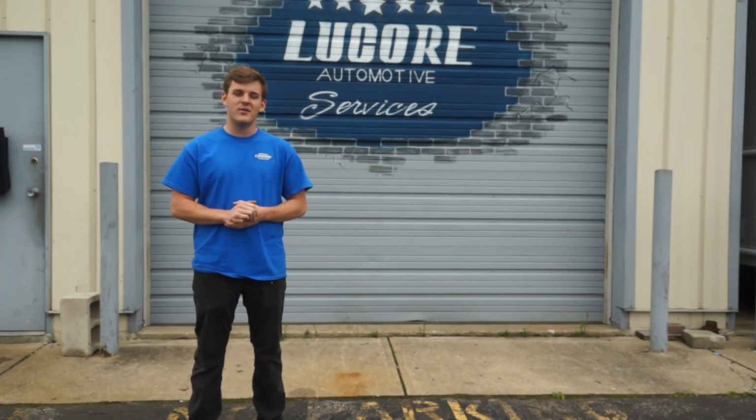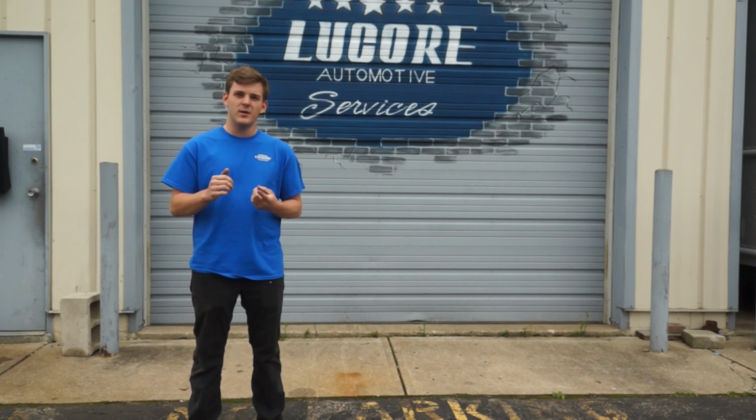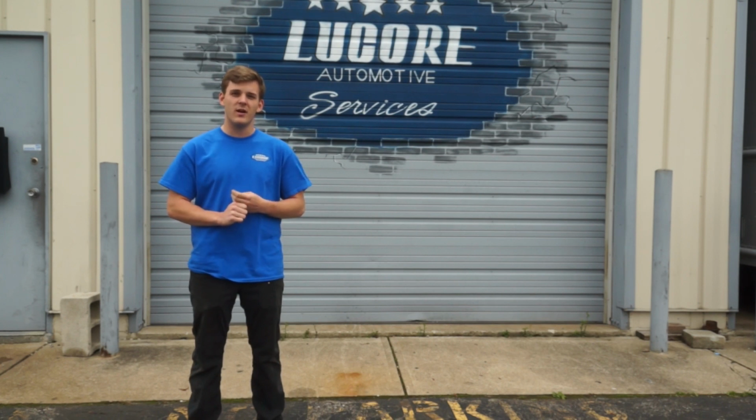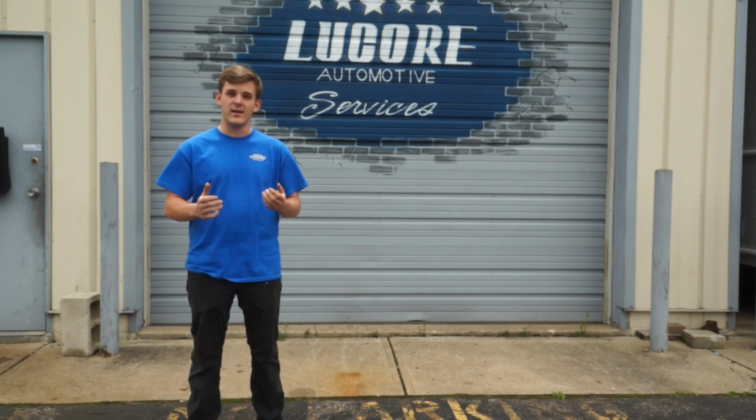All right, that's gonna wrap it up for us here over at Lucore Automotive. We were able to diagnose and fix the vibration in the rear of the car with two new tires. We checked that line lock works, lowered the car 1.5 to 1.8 inches, like we said earlier, and took it for a test drive to make sure we hadn't sacrificed any of the ride quality of the car in exchange for lowering it. And since everything's okay, we're going to go ahead and ship the car out.